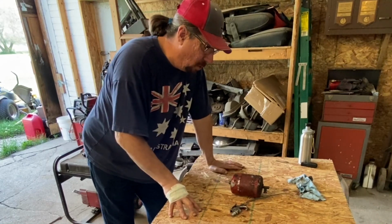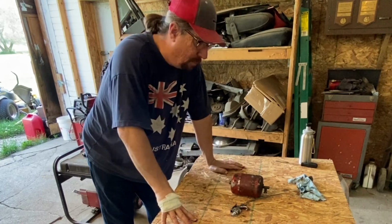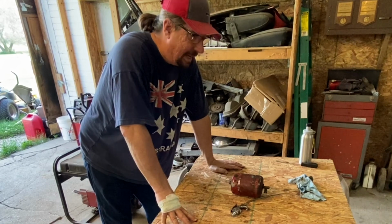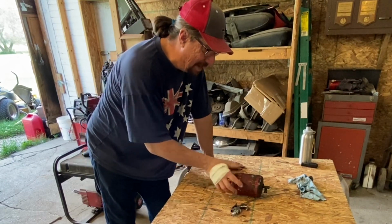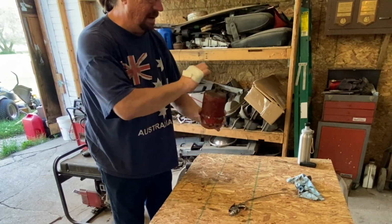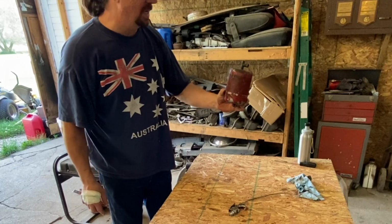So if I hadn't said that before, I got a Fram oil filter with a replaceable cartridge that looks similar to this that we'll be putting on the car. It's not exactly factory, but it's close to this, and it's going to do the job. So if that ever shows up, we'll show you that. And just in looking at this, I'm 90% sure, because the oil pressure gauge feeds off of here, pretty sure this is the inlet and this is the outlet. 99.999% sure that's the case.